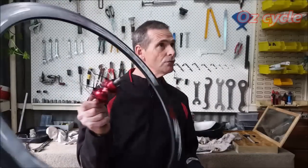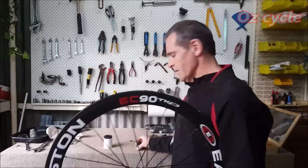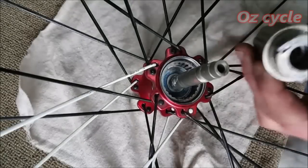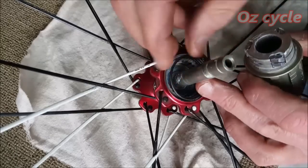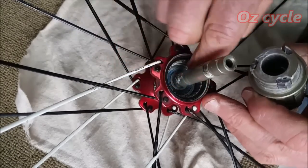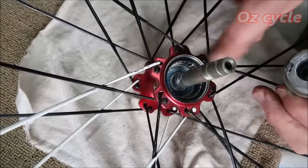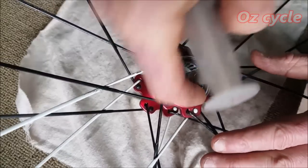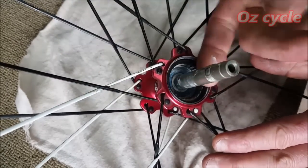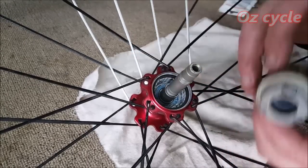Axle's all in, nice and smooth. If you can do all this so far, you're on your way to being a good bike mechanic. Next step: the clutch. Very simple — just need to grease it up and put it in. Before we put the clutch in, some hubs will have a little plastic seal that goes between — put your seal in if it's got one. Make sure you get it around the right way — get it around the wrong way and it will make the clutch go all tight. Then just a slight smear of grease on the rest of the axle. Don't forget the spacer washer, then your clutch.